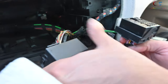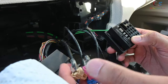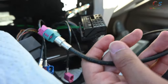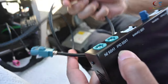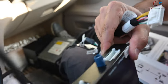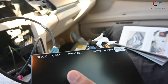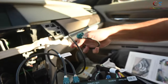This will go back to the CIC unit, along with all these wires — except for the LVDS cable. The LVDS out cable from the new system will go into this pink connector here — it just clips right in. Then this one will go into the output of the box. LVDS out is the cable we just connected, and that goes here. Next is the CAN power cable, which connects right here to the CAN power cable. The LVDS in will be the other cable, which goes in here, and this part of the cable connects to the head unit.